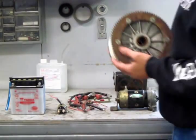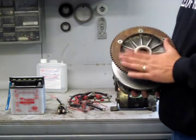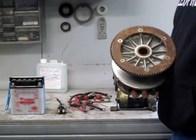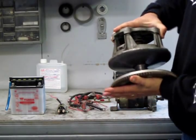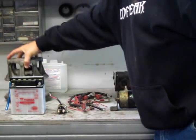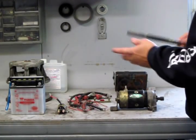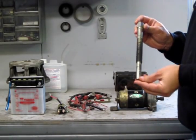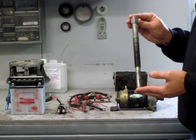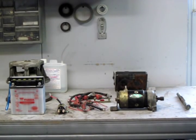Now, if you get lucky and check the back of your clutch and it's threaded, all you have to do is get the ring gear. This particular sled did not have the threads on it, so we had to go and pick up a whole clutch. And specialty tools for this — you're going to need a clutch puller. They're model-specific, so you're going to have to look for it if you don't have one already. So let's get ready and put her in.